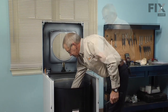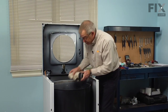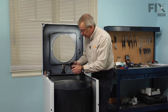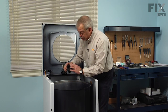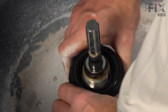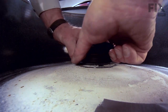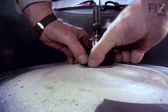Next we're ready to install the tub seal. Make sure the inside lip of the outer tub is nice and clean and free of any debris, and the same with the rubber edge of the tub seal. You can moisten it with a little water to make it easier to put on. Take caution not to squeeze the top of it or you will crack that carbon face. Grasp the bottom of it and twist it into place, making sure it goes flush at the bottom of the tub. Once bottomed out, depress the spring in it to make sure it doesn't bind on the side of the tub bearing; if it does, rotate it a little bit.